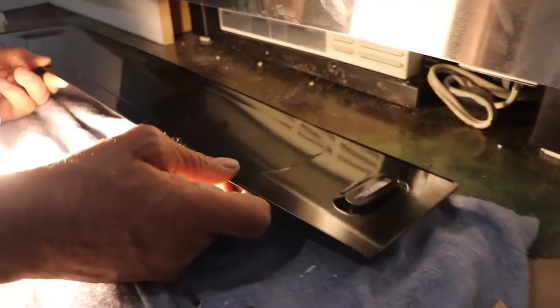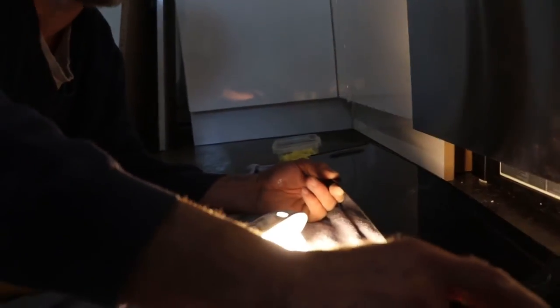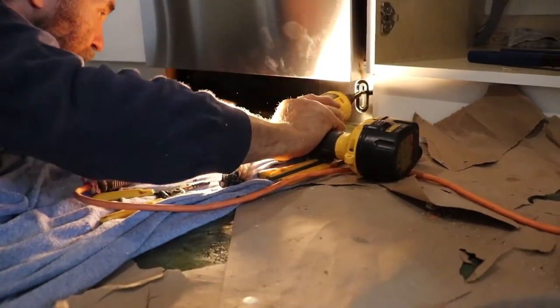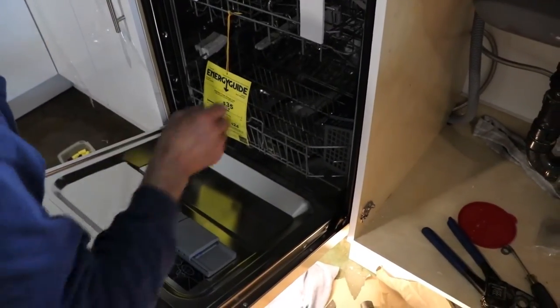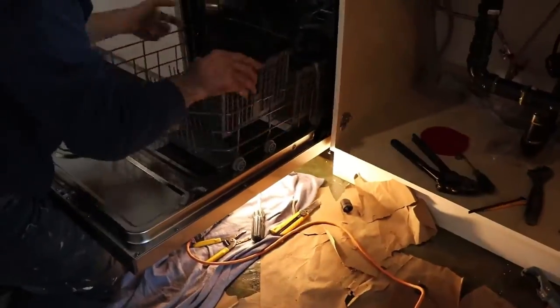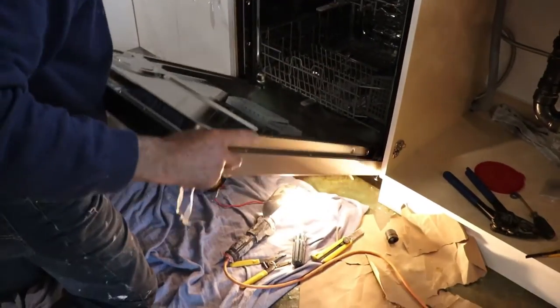Electrical is connected. You see there's a big gap on this guy — so in case your cabinet is a little bit too high or you need to put the machine a bit higher, you have about an inch and a half to play with. Once this is done, clean all this stuff out. When you install a new dishwasher you just gotta remove all the paper and everything that is inside. This one is good to go — we just have to test it.